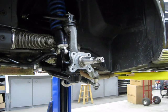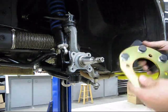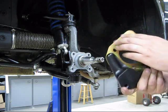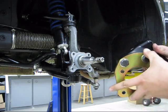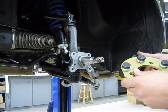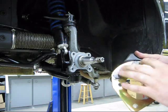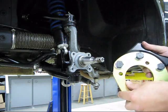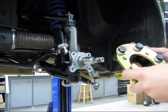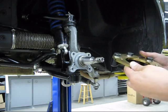The first step in installing this brake system is to put the bracket onto the spindle. It's a two-piece design: a laser-cut steel plate that's yellow zinc chromate plated for corrosion protection, with an aluminum bracket that bolts onto it. It's all shipped assembled with red Loctite, and there's a left-hand and a right-hand version so you don't have to mess around with any of this.